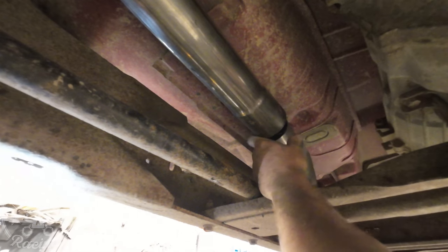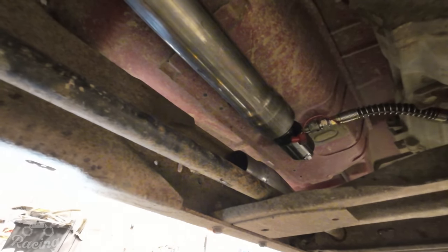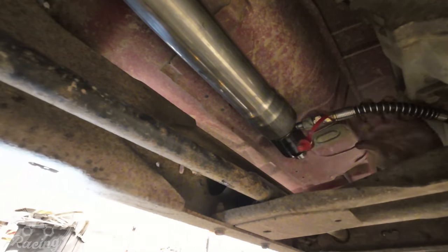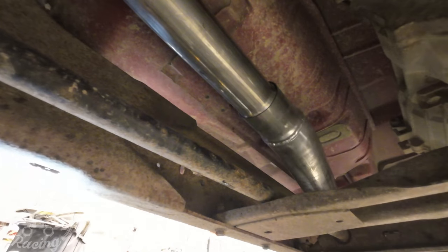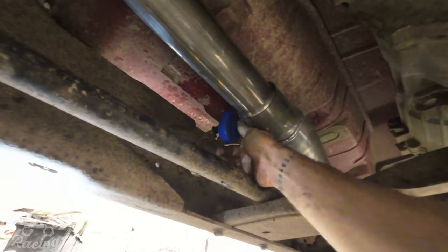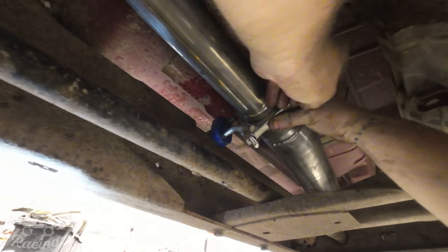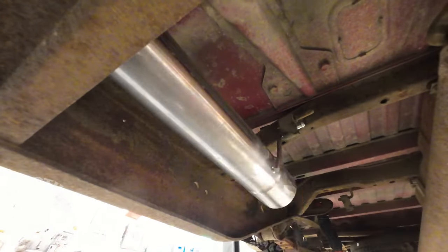Some of the things you'll have to move to line up again. You can see that one fitting is really, really loose — and it's funny, this kit had one review and it was exactly that complaint. I just used my hydraulic expander to expand it out so we had a nice tight fit, and the clamp will do a much better job that way. For the band-style clamps, I mock up the whole system first, then remove the clamps, tack the pipes, and put the clamps right back over top. That keeps the system from rearranging itself as you're driving and hitting bumps.